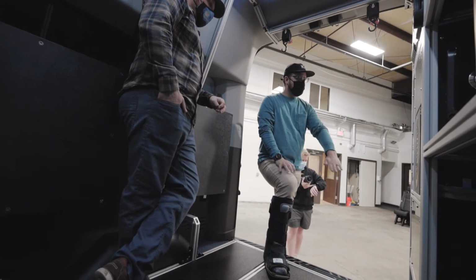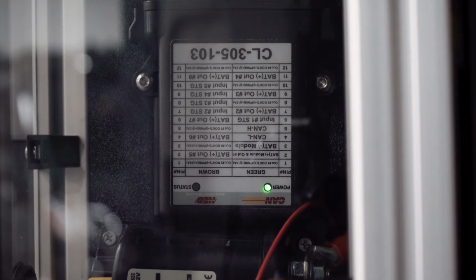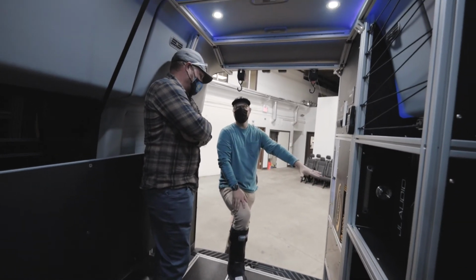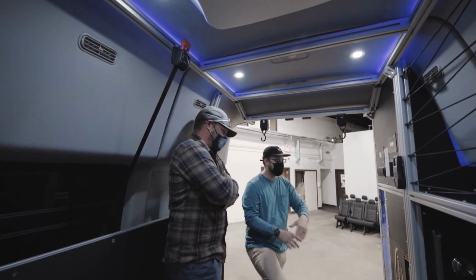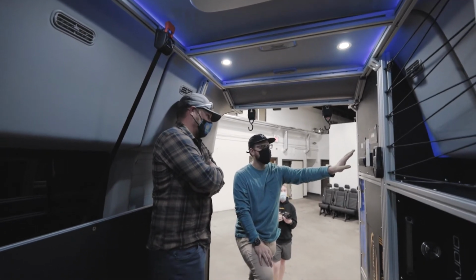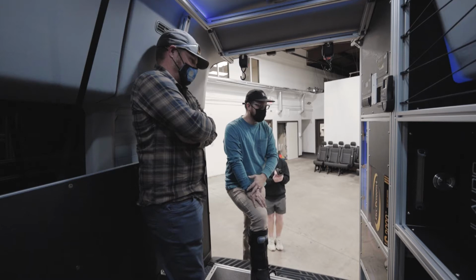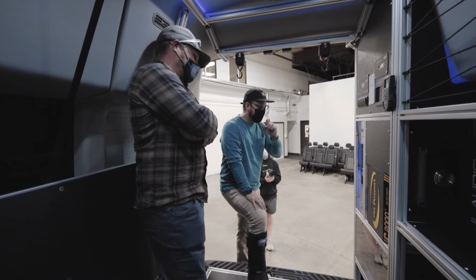Cool. Moving up, I'm going to mention this CL305 device because it has a flashing red light. That is the most common thing we'll get a photo of in our ticket system. It means everything is fine, just because it's red. Flashing red on status, we're good. This is actually the pre-programmed module for your rocker switches. So it sets the timing and lighting and what they do. But if we have any issues, we get that question. So just to let you know, it's a poor color choice from that manufacturer. Maybe blue would have been a nice option, but just wanted to point that out.